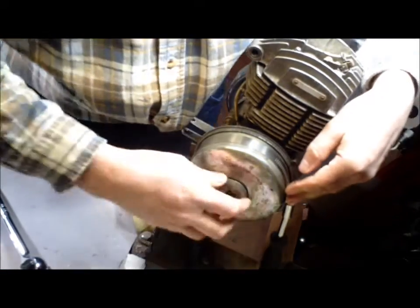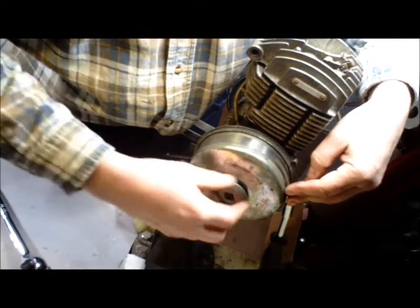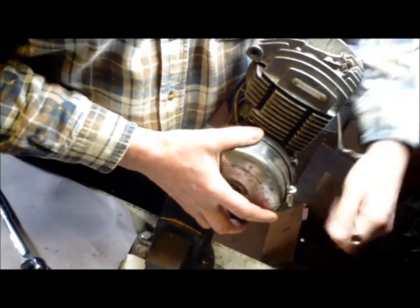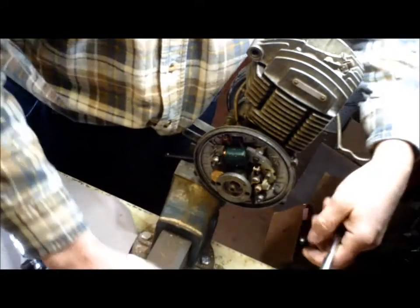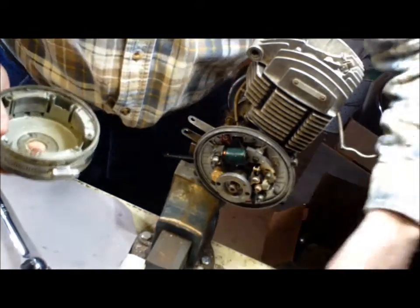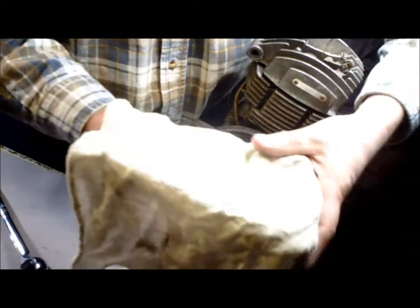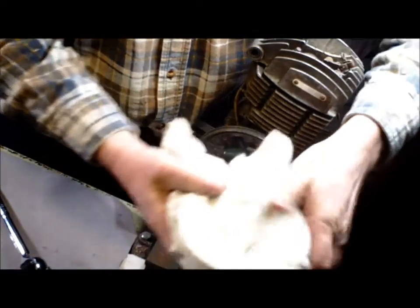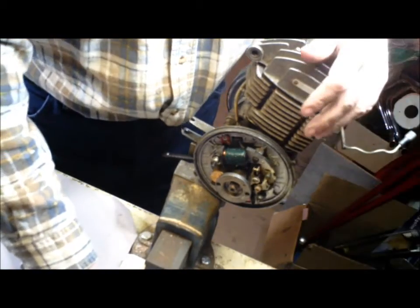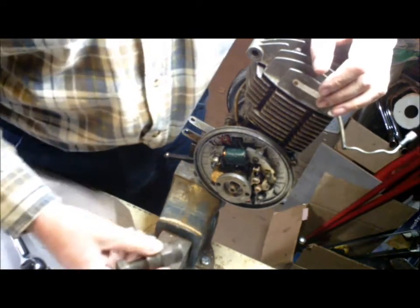There you go. You don't have to bang around with a hammer and fight and get out all sorts of other toolage or anything else like that. You can put that clamp on there like that if you like. Always make sure when you put the flywheel somewhere that it is somewhere that you haven't been grinding. Throw a rag around it just in case, because if you get any metal on that thing it is going to be stuck forever, or just about forever.